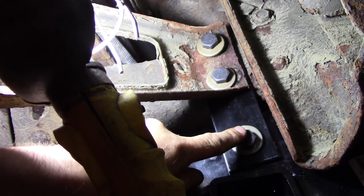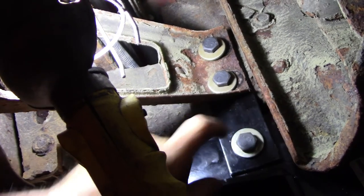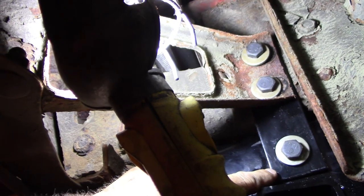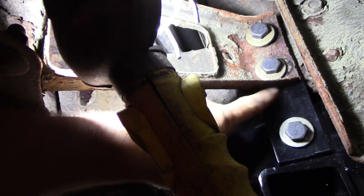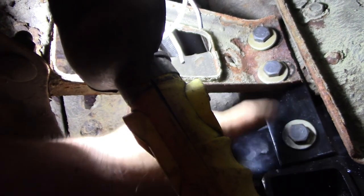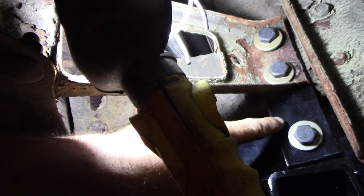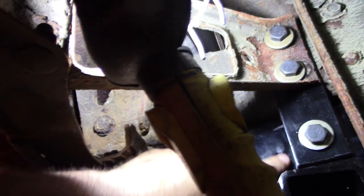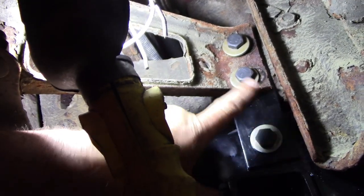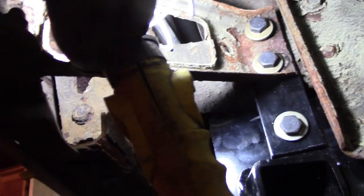This is the hanger — the bottom bolt and the top two bolts that go to your bumper bracket — so that's what I'm tightening now on both sides. It's pinched in between this and the frame, which is why we had to take those two bolts out, slide this up in there, and this plugs into the hitch. Six more bolts to tighten up and we're good.